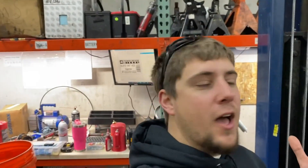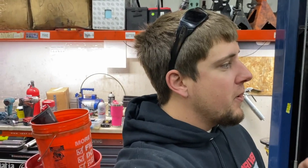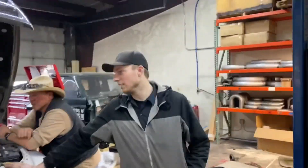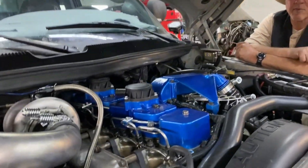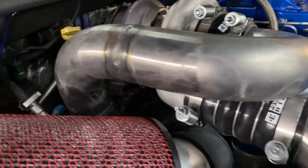Hey guys, welcome back to the channel. We got an update on Meyer's dad's 12-valve build - he's up here again, we got it on the dyno. For those of you that don't remember, Meyer's going to go over the details on what's done to this pig. It's a 12-valve, we put a 6.7 crank in it so it's a 6.1 stroker. We did main bolts, rod bolts, 178/208 PD pushrods, 60-pound valve springs with chromoly locks and retainers. Right now it's firing with an HE351 with a 67 turbine over a S472 - so it's a 72/87.